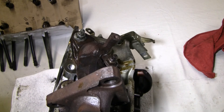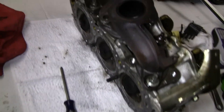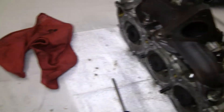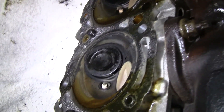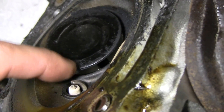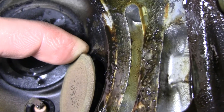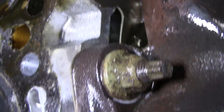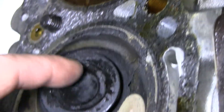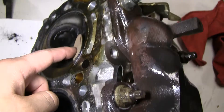I'm going to show you what I had set up to get that thing off. It's pretty telling on where I'm having issues because if you look — oh look at that, what's this? That's a pretty big gap. This one too, that's a pretty big gap. Those are two pretty significantly bent valves. Obviously they should not be like that at all. And you can see the other ones are a little bit better, but these are just horrid.